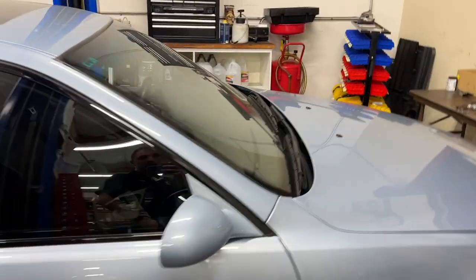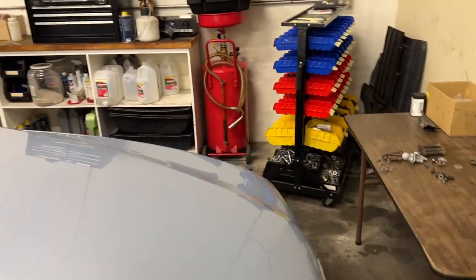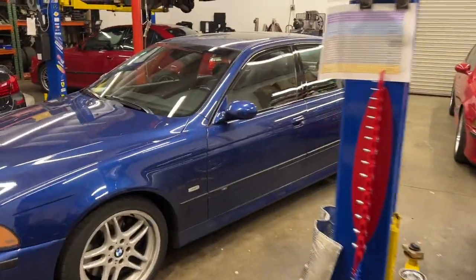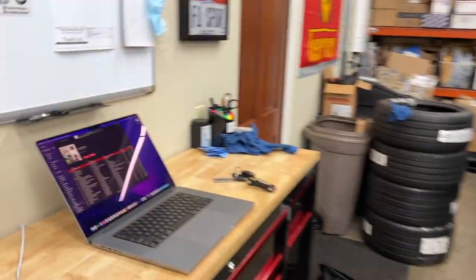Lots more bleeding to do, some interior reassembly, and that's the ceiling over there — I just want to make sure everything's dry in the clutch. We bled the clutch with the pressure bleeder — put 15 psi in there, opened the valve at the bottom, waited till the bubbles stopped. That seems to have worked really well. The clutch feels good.